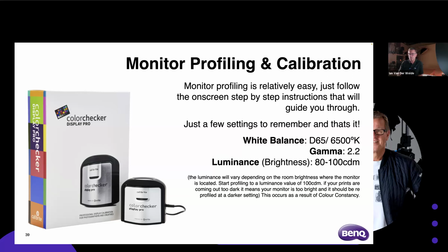Now, the last one's quite tricky, and that's the luminance. Luminance just means brightness, and you'll see there that I have a range, 80 to 100 candela per square meter. That's just a measurement of brightness. The reason I can't give you an accurate figure on what to set there is because it really depends on so many other variables. If you have your monitor set up in a room that's fairly bright, it would need to be set at a brighter setting than if you're in a darker room.